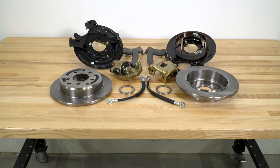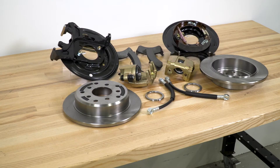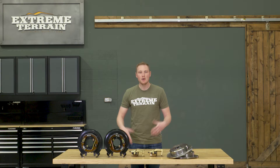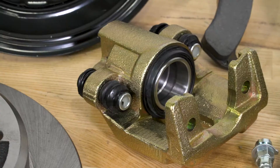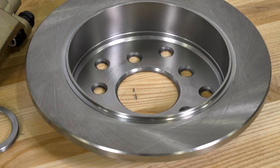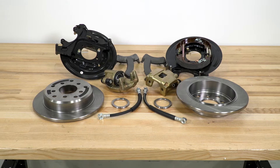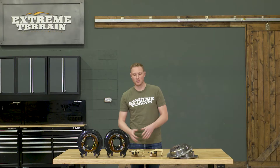Overall, I think the components in this kit are very high quality. You're going to get your backing plates that are going to have your caliper brackets built right into them, and these are designed for an emergency brake that goes on the inside of your disc, which is pretty traditional for a disc brake setup like this. Those are going to give you some pretty good holding power. Of course, these are going to come with single piston calipers out back and your rotors as well. You're going to have your pads — really all of the components that you need to get the basic system installed — and then you're going to need all of those additional parts we talked about before to really make this work properly.